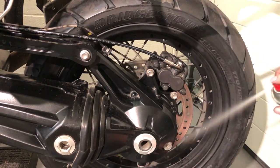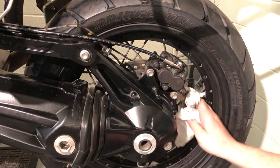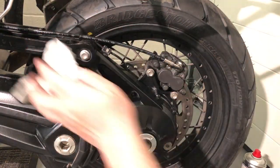So I've just done the pins at 17 Newton metres and 40 Newton metres for the bolts. The wheel's turning fine so a last-minute brake cleaner clean all around just in case there's any grease or residue left over. All done.